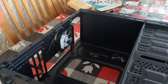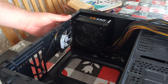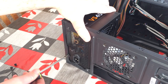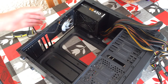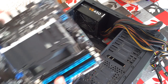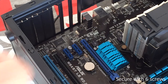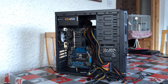The power supply should go in next because it will give us an idea of how much room we have left to work with. Your PSU may go at the top or the bottom but installation is the same — four screws will keep it in place. The motherboard can then go in. Remember that if you have a back plate, install that in the slot first and ensure your motherboard standoffs are in place. Most boards once in will need six screws to secure.